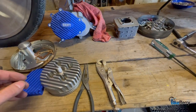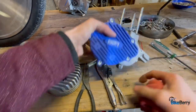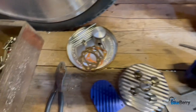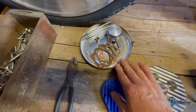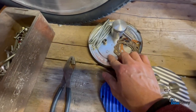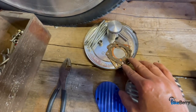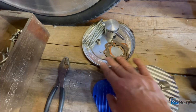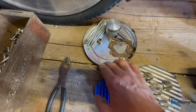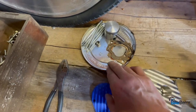Now it's time to make the switch. Let's go from that engine because I don't want to tear it all apart — this is the one that I froze up because I ran it too hard before it was broken in. Something to keep in mind is a tray of some sort to keep your parts in. You have a lot of little clips in here that you don't want to get lost, your gaskets and everything. I suggest some kind of tin or tray, like a parts tray. I use these old tin film canisters that I think are cool.